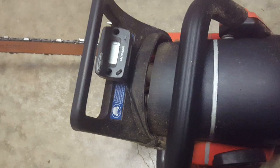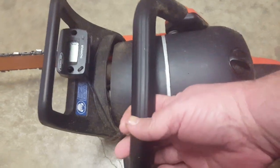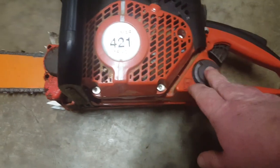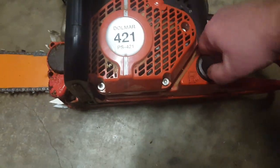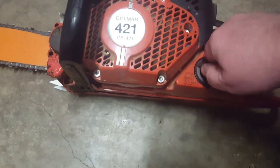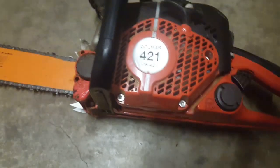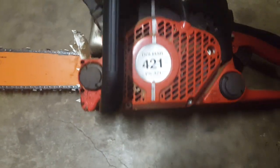As you can see, I've added a tach to this one as well. I get these off Amazon or eBay for like 20 bucks — wires in really easy, makes it easier for me to tune the saws. The caps you'll notice right away are different. I actually just put those on today — they're Husqvarna flippy caps. Picked them up and they seem to seal very well, screw on well.